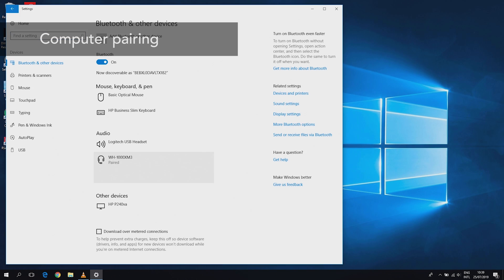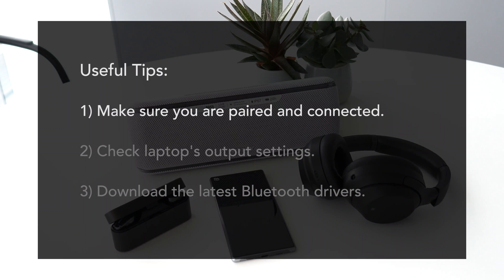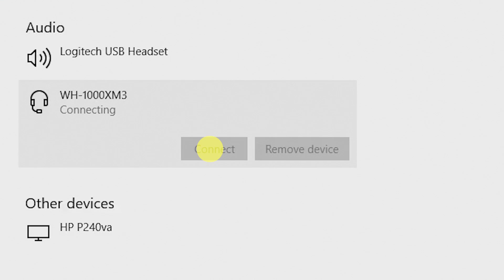Start fresh. If you have successfully paired your headphones or speaker with your computer and your device is registered in the Bluetooth device list, but the connection isn't happening, make sure you go into the Bluetooth list and press connect to make the Bluetooth connection active. Smartphones have a tendency to automatically connect; computers don't always.